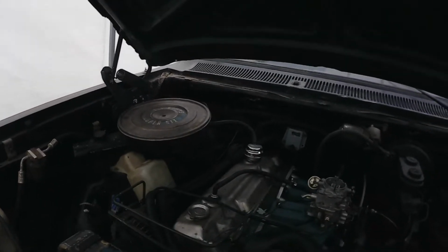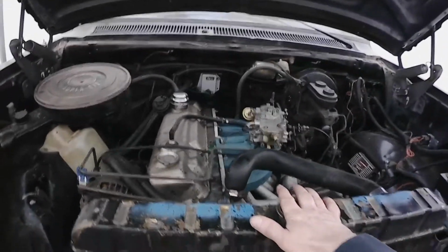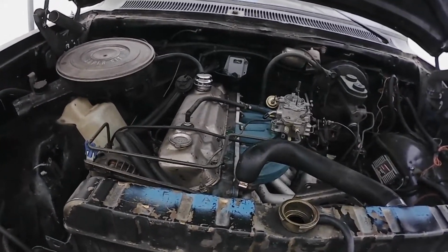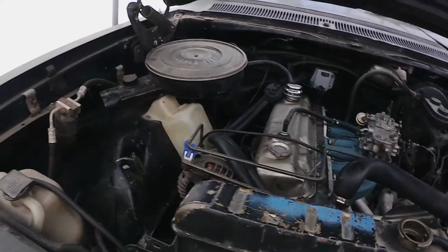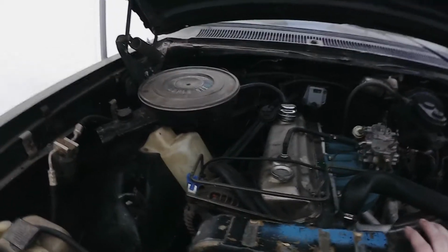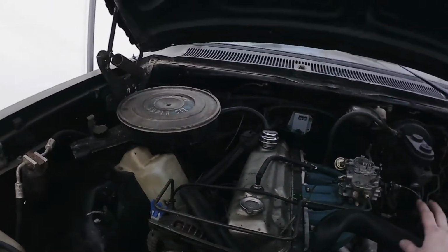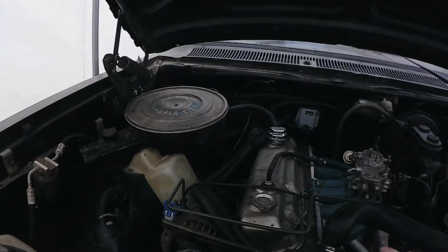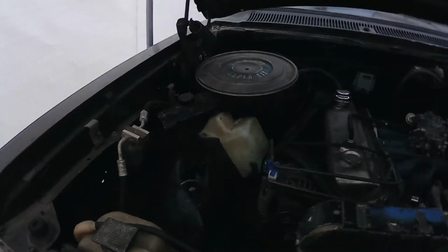I was using my dad's truck to move, got the move done, and the goal here is we're about to get some cold weather, at least for my area. I'm going to get down into, I think, 20 degrees, something like that. And my antifreeze is not, well, it's water with a little bit of grit in it, so it's not quite on par. So what I think I'm going to do is just go ahead and start it, which isn't going to hurt anything, and get it up to temperature, add some pure antifreeze in there, let that cycle, and then that'll get it prepped for winter.